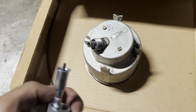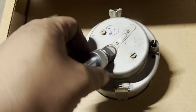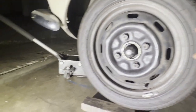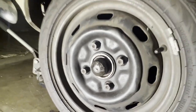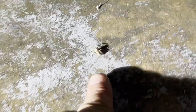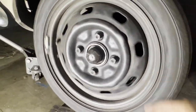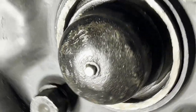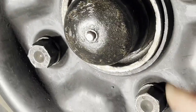The hubcap is off and the front wheel is lifted. Before I take off the wheel, you can already see where the other end of that cable goes to. Basically, as this wheel spins, that inside cable spins all along the inside and sends the signal over to the gauge — that's how that works. Since my original one broke, I think it snapped right behind the gauge somewhere. I'm going to go ahead and replace this — it's super easy. You just pop off this cap, pull off the old one, put the new one in, put the clip back in, and we should be good to go.